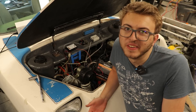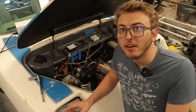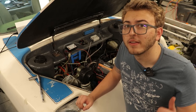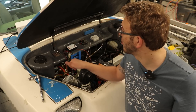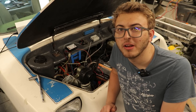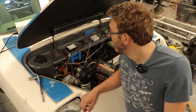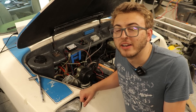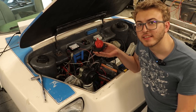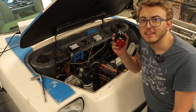I've figured out the issue. There's a purple wire that connects to the controller — that's the high voltage connect cable — and when it's connected to the positive terminal of my battery pack, the controller turns on. In my other car there's a contactor that controls whether the purple wire is connected or not, but in this car there's no such contactor. So I'll add one, but I don't have the part right now. What I do have is this emergency high voltage cutoff switch — I was going to install it in the car anyway, so for the moment that's going to serve as my ignition.